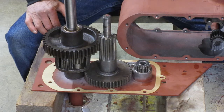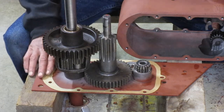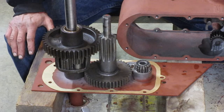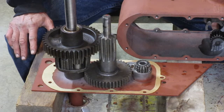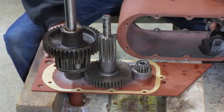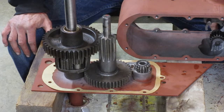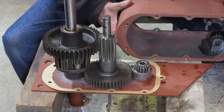So we're ready to put the case on. The reason I did not put gasket sealer over the entire gasket here is because all the parts I'm putting in this transmission came out of various transmissions. I had a bunch of junk ones laying around, so I'm going to just make sure everything is free and working first. If you glue these down well, you'll ruin the gaskets taking them back apart if something doesn't work right. Normally not an issue if you're putting the same pieces back, but here I have a lot of different parts out of different transmissions.